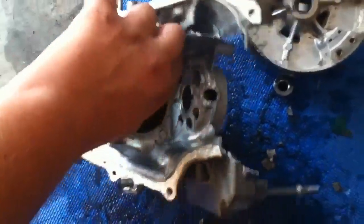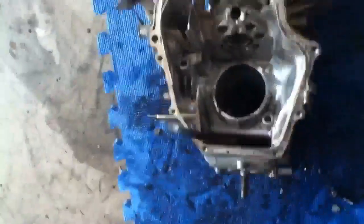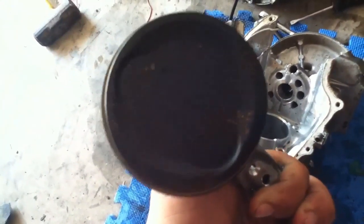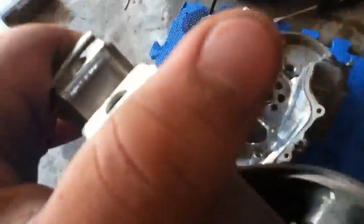I finally got what I was looking for - the piston. I'm going to pull it out. And there's the piston. There are some chunks in there - I wonder where that's from. That's what the top of the piston looks like - it's all black. You can see where the valves go. There's the rings: top two rings are for compression, that bottom one is for oil. The oil ring scrapes the oil off the sides, and that little hole there is to lubricate it all.